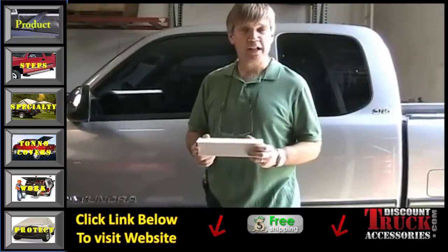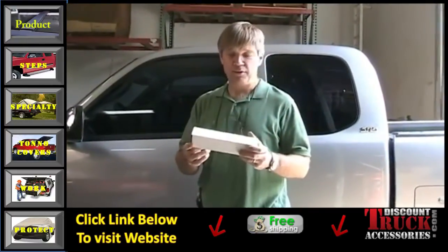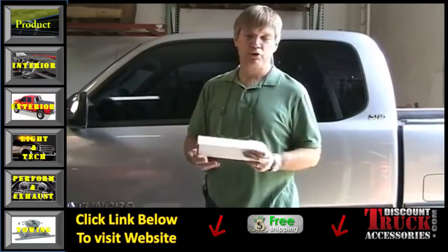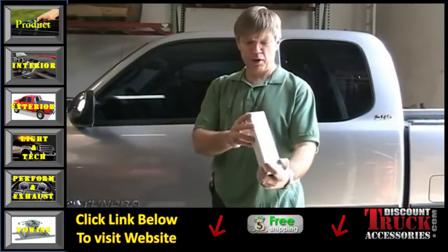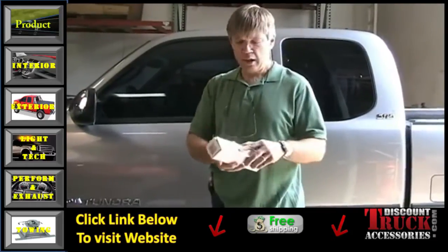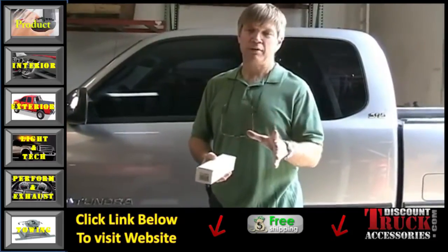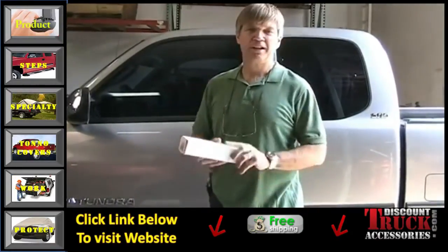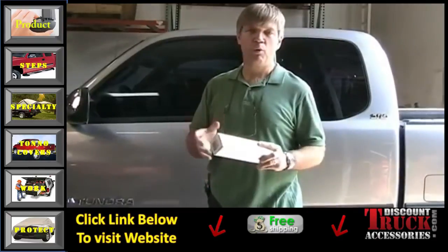One of the parts you're going to need is our rain gutter bracket. This replaces the rain gutter on most of your newer vehicles. We've developed this so you can attach our light bar to it — it's basically a box. It's part number 220052, and it's important you get the right rain gutter bracket for your vehicle. Our bars fit almost every truck out there, but if you get the wrong rain gutter bracket, it won't install properly.